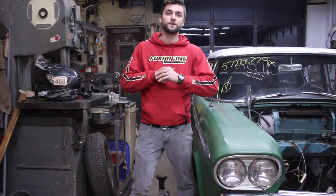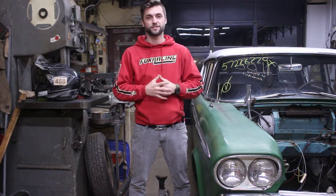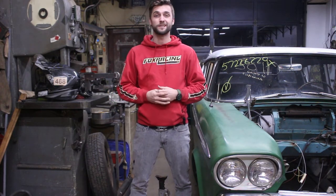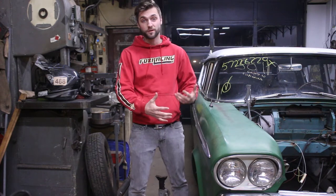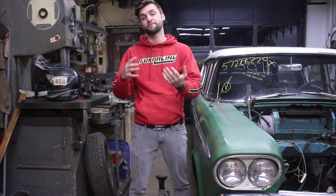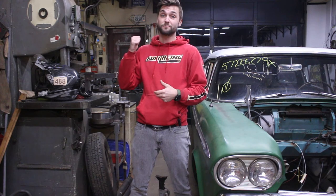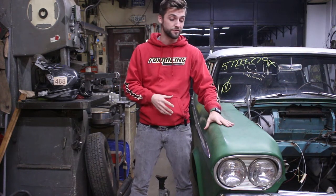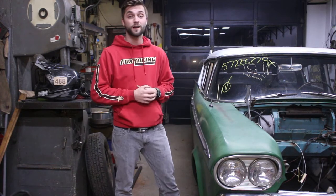One thing that's very important before we start figuring out what kind of suspension setup we're going to run and where everything's going to mount is to have your tire and wheel setup sorted out. This means you can start planning where the tire and wheel combo has got to ride and what your offset is, so you don't build suspension geometry and then have to find wheels and tires to fit later. We're trying to build this from stuff we have or right out of the junkyard — recycling basically everything. My dad is just getting back now with a bunch of wheels and tires we can try out.